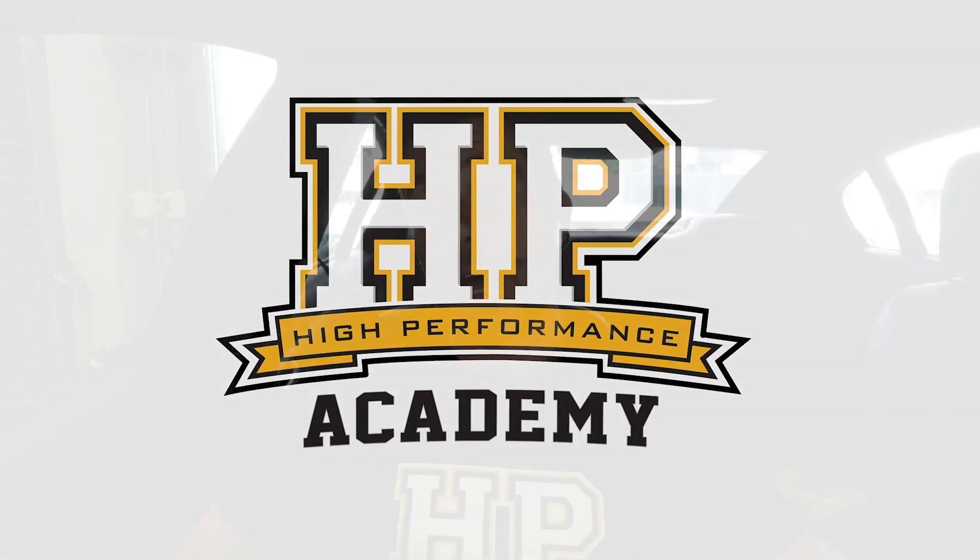It's Andre from High Performance Academy, welcome along to another one of our webinars. This time we're going to be looking at how you can go about rescaling the mass airflow sensor if you are reflashing a late model factory car. Specifically our example is going to be our GM L98 engine, pretty similar to an LS2, and we are going to be using the HP Tuners tuning platform. The techniques and principles are going to be applicable to a wider range of vehicles as well, so something for just about anyone into reflashing modern engines fitted with mass airflow sensors.